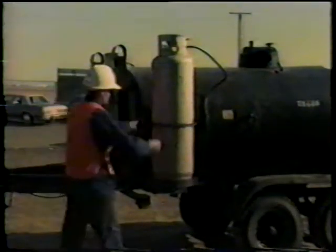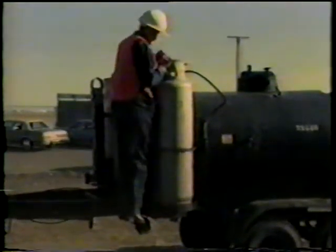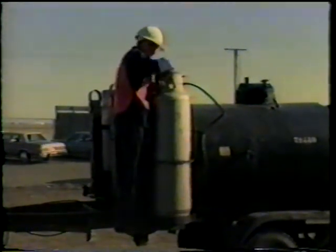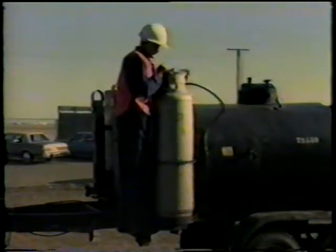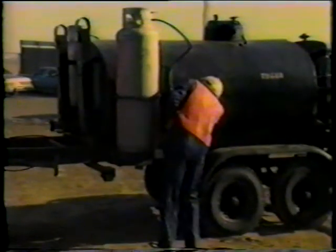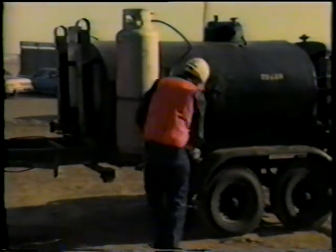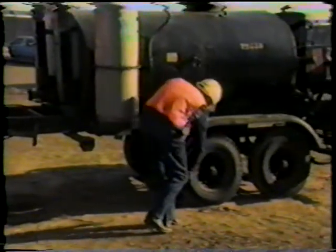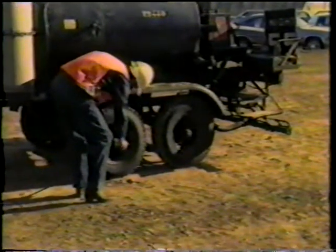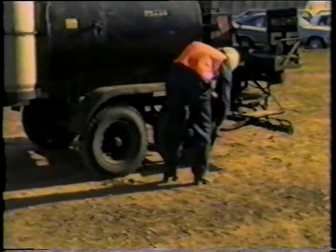15th, move to the other side of the distributor and check the propane tank as we did on the opposite side. Also check your thermometer well for oil level. The thermometer must be covered with 10 weight oil to read accurately. 16th, continue with your tire check the same way as previously covered.